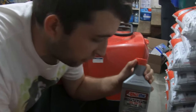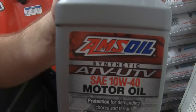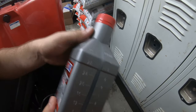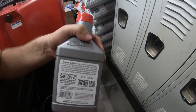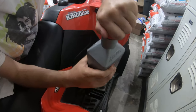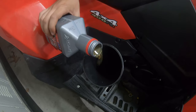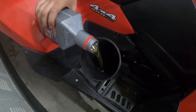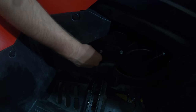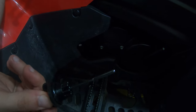So today we're going to be using this Amsoil Synthetic 10W40 motor oil — it's the ATV-UTV oil. You need to make sure it's the ATV-UTV oil or motorcycle oil, as long as it's compatible with the wet clutch. So now we're going to put 3.4 quarts in. Put the dipstick in flush and check our oil, and you can see it's filled right up to the top.